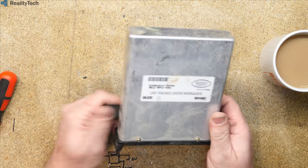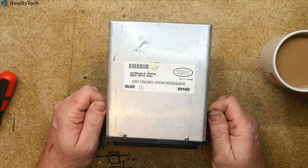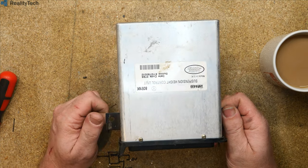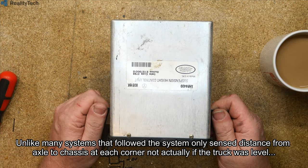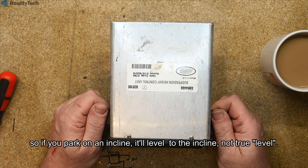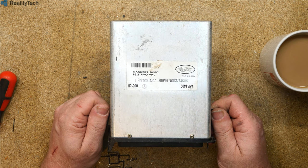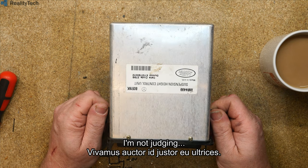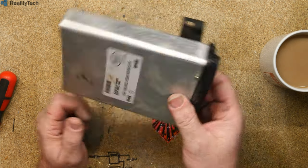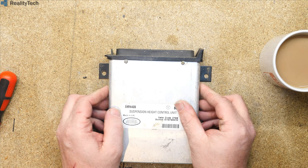For those of you who don't know, the Range Rover P38 was the second version of the Range Rover that Land Rover made, fitted almost universally with air suspension. At the time this was amazing — a big selling point. The system could self-level the vehicle, adjust ride height for comfortable on-road driving or maximum ground clearance off-road. The system was okay at the time but a lot of vehicles are getting old and crusty now, and sadly a lot of people decide to put springs on. This module lives under the passenger seat and controls the system, so let's see how far we can get into this before we need to deploy a drill.